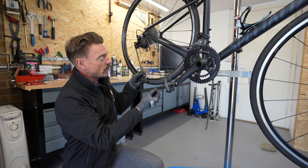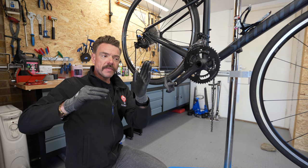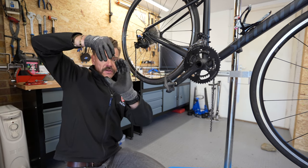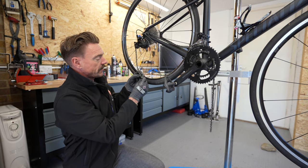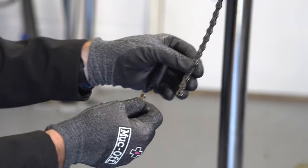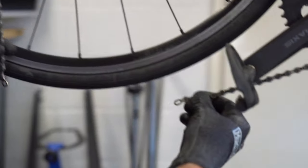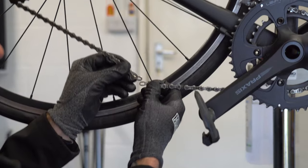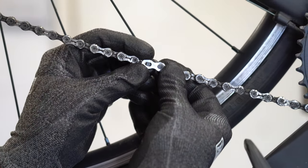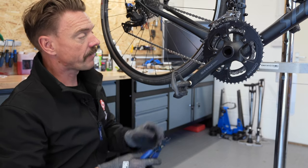What you're looking to do is put your two quick links in Siamese together — one comes in from that side with the pin there and one comes in from the other side with the pin there, so they do that. I'm going to shove one in this end from the back and push the other in from the front. Then — the fiddly bit — you've got to pull down on the derailleur a little bit, bring them together, push the two halves through each other, and then pull the two apart to lock that in place.